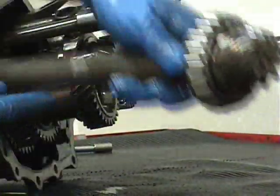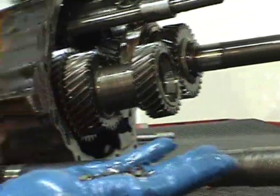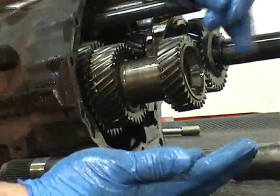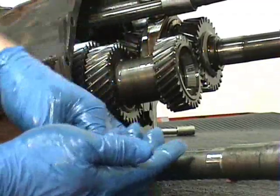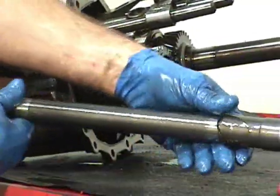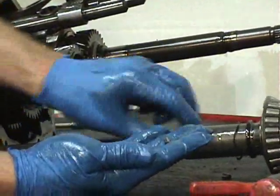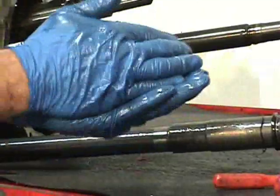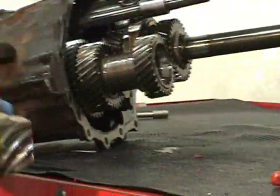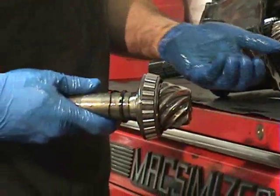Inside of here, there's going to be a bearing that sits on here, so you want to get that out. And you usually throw these in a Ziploc. There's also a wavy spring that ends up sitting on this as well. Once it's all together, it ends up there. So keep track of these. Throw these in a Ziploc bag. There's 23 of these. You know, check this surface for galling, just like any of the other bearing surfaces. If it looks smooth and clean, you're good.